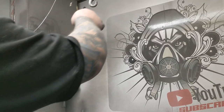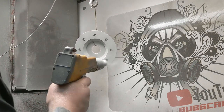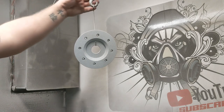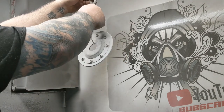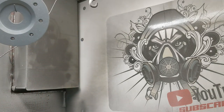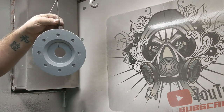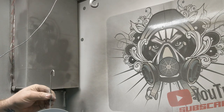And on these, I don't intentionally shoot the back. Powder will get on the back. One of the things you want to make sure to avoid is stacking too much powder on the back side of these, because when you go to mount them down in the faces, if you have too much powder up on these ridges and you have powder on the face of the wheel, this plate won't fit down into it. It'll be crammed in place. Some local coaters have done that and had to sand everything down to get it to fit, or they get them into place, but then you have to figure out a way to get them off. And when they're mounted on a car, that's nearly impossible.